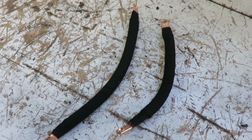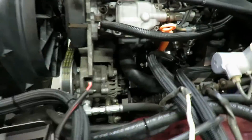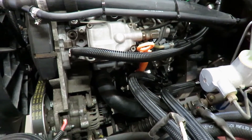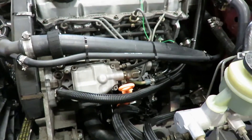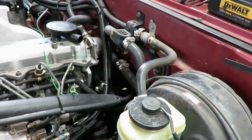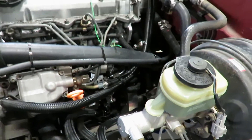Now we're doing some ground cables, and it's very important to ground everything correctly - your ground placements are very crucial. The battery ground needs to go to the engine block, and the alternator and starter all ground to the block as well. That's where your heavy gauge negative ground cable goes. Then you want to ground the block to the frame and the block to the body, for all the electronics grounded to the body and whatever is grounded to the frame.